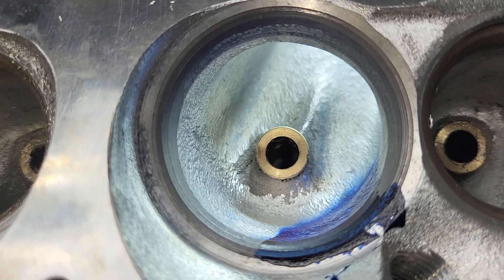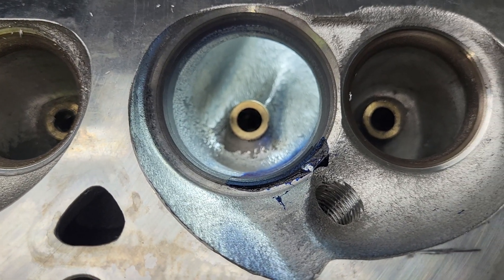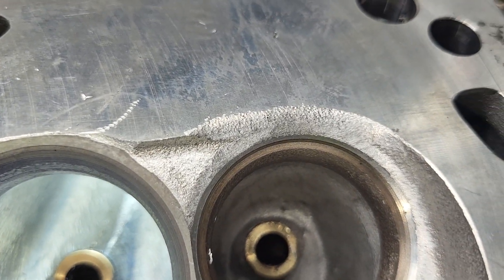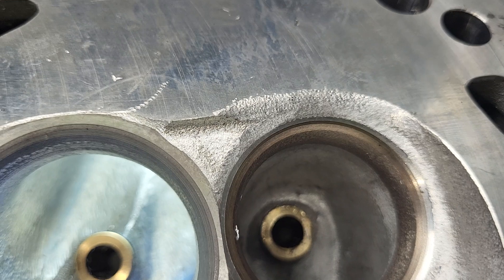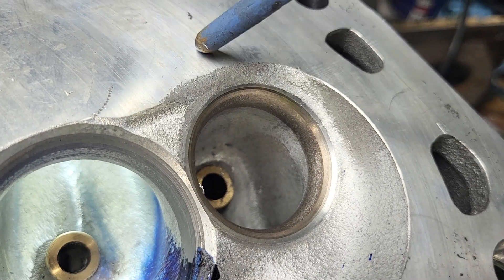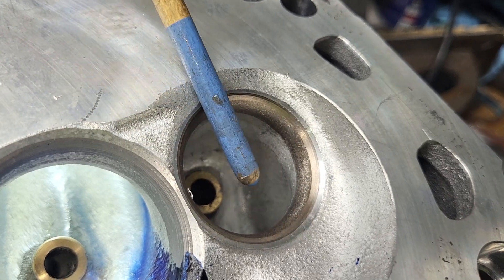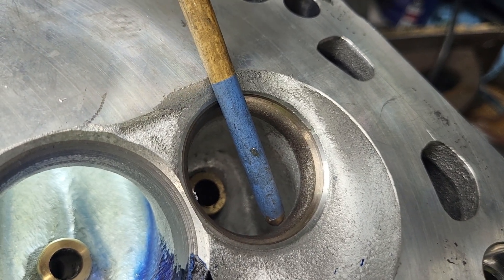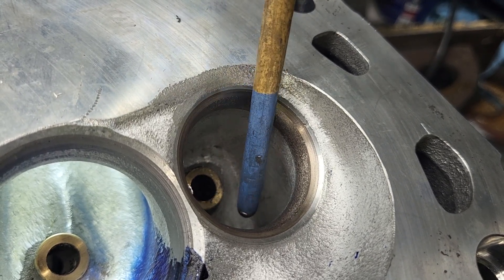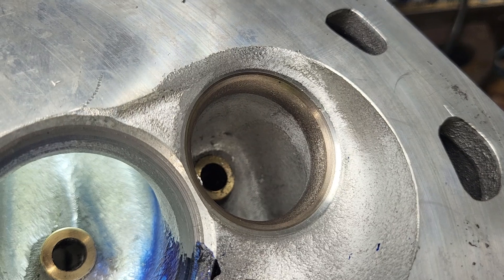You can see I didn't really do a lot around the guide bosses — don't really need to at this point. The chamber is basically taking the rough edges out and putting a small DV plateau around the exhaust. I don't like to make a huge one. He makes it completely flat; I don't — I make mine rounded. He would start his further back and come straight into the port. I like it a little more round — I want the air to come around and go into the bowl a little deeper. I don't know which is the preferred method; I know the way I like to do it.